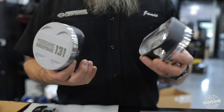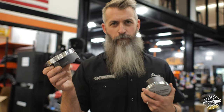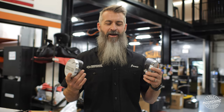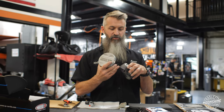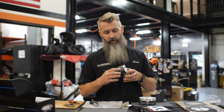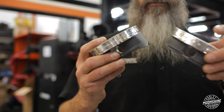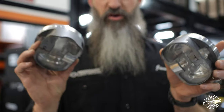The pistons we use in our motors have full skirts on the front piston, and we now relieve the front of the rear piston for clearance when it comes down. George Bryson from Star Racing taught me that. We want to keep the major face on the front and not cut it — losing material there — because that is the driving face. When it's coming down, you want your major face to have all the support it can. So we take a little bit out of the minor skirt on the rear piston, so when they come to the bottom they don't cut both sides.